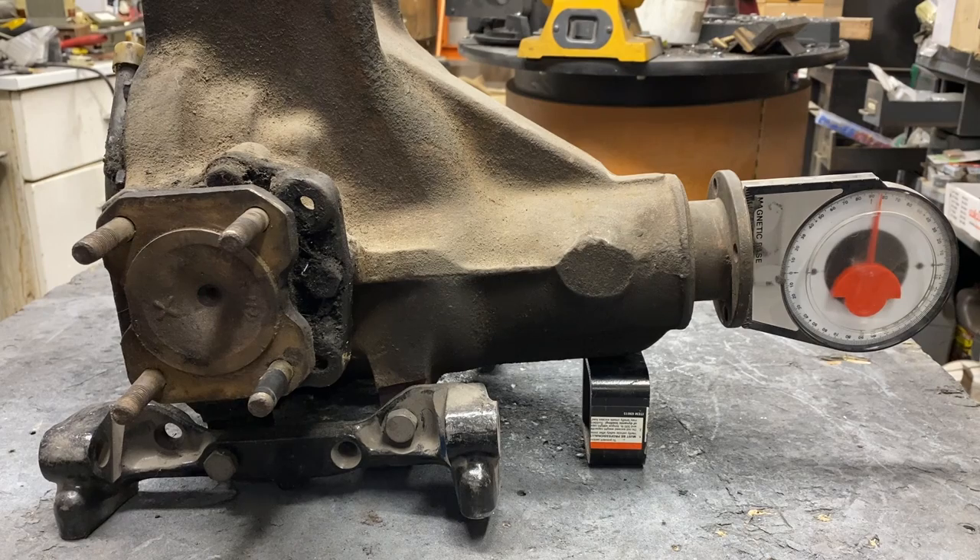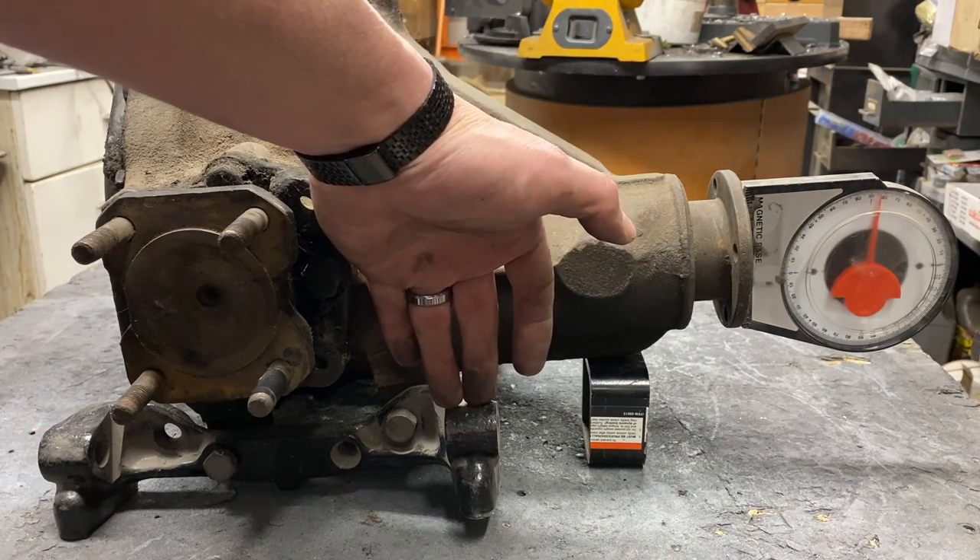But with a Jaguar independent rear suspension, you can make it so that the suspension does indeed travel perpendicular to the road. And if you can do that, why wouldn't you? Because it's going to make a much better setup. From a practical standpoint, making the lower control arm move perpendicular to the road would be as simple as raising this in just a little bit and lowering this in just a little bit.